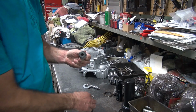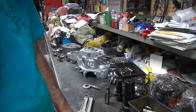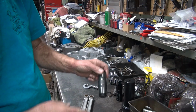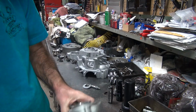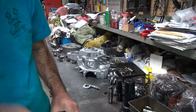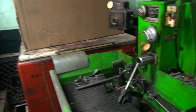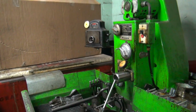This was 9/10 under. The rollers are 2/10 under what they should be. That's 4/10 because it's 2 on each side, because we've got roller on this side, roller on that side. So that puts us at 1.3 thou under. I want to make these things loose, so 1.3 sounds just about right for me. So that means that gauge over there should be on 0 to give us 1.3 thou clearance, which is 13/10, depending on what nomenclature you like to use. I tend to talk in tenths of thousands, so I'm looking for 13.